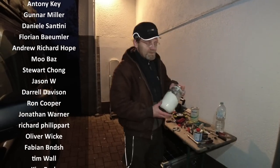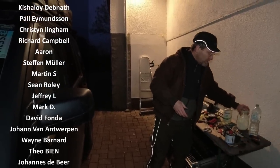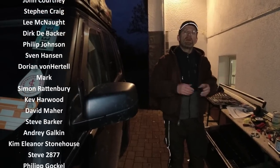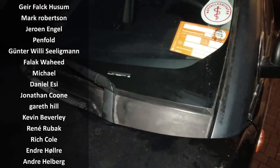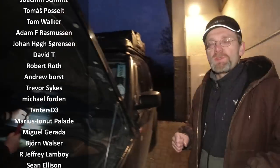One more secret: this is regular flour for 99 cents — put a lot of it on there and blow it out. You will see where it flies away and that's where you have a problem. We also forgot these clamps — we have to open the hood again. So not fixing a water leak can have a lot of consequences, so get simple stuff done like this.